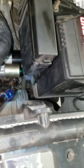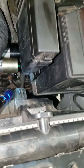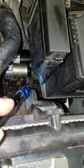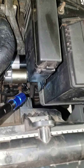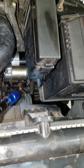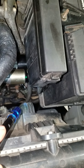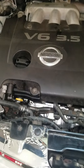If you have difficulty getting that connector on, you need to pull it up and let it sit on that clip. There's a little groove on that black coupling — put the clip in, and then you can rotate it into position. If you don't get that connector harness on perfectly and fully seated, you'll put the key in and it'll go kachunk. The starter will try to fire, the Bendix will come out, and that's it. Something strange will happen, and that is due to that connector, so you gotta have it connected and fully seated.